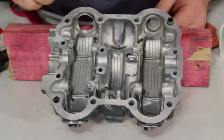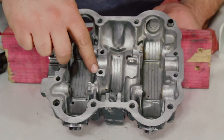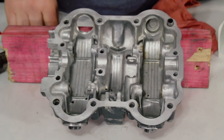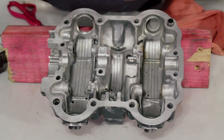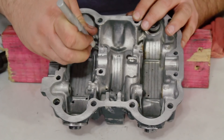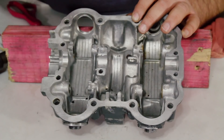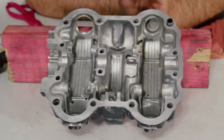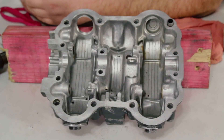I'm going to go ahead and apply some of the aluminum tape — two layers on either one of these pillars. I already did one off camera. I'm going to do this one for you on camera. You just need a very small piece of tape, not a whole lot — it's essentially aluminum foil. Make sure you get all the little bits and pieces off; you don't want any little pieces of aluminum floating around the engine. Make sure you get a good clean cut all the way around. That's it. Those two thin layers of tape on both of these posts makes all the difference in the world when putting the valve cover back on.